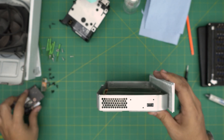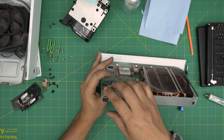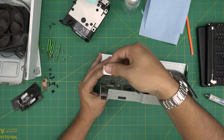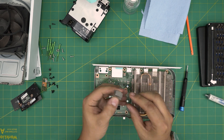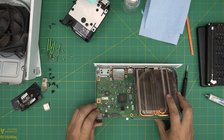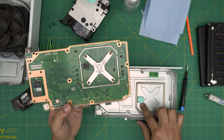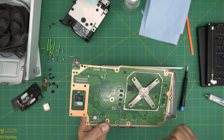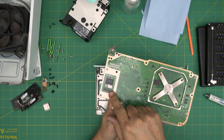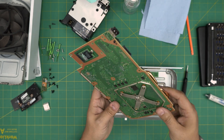Lift the front panel up evenly from one side, then remove the Wi-Fi antenna. Lift it up evenly. Now remove the lock system on the USB port by bringing it straight upward. Then lift the board up, bring it toward yourself — on the bottom you can see the thermal putty for the RAM. This is the internal memory storage, and the hardware is right there.